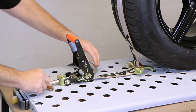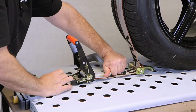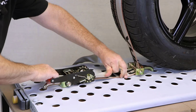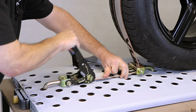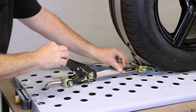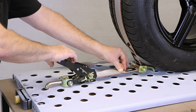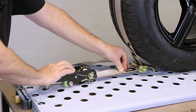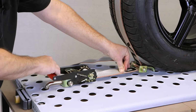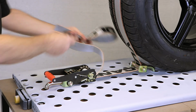Once you've decided where to place it, you insert your hook and remove all slack by hand, and then you use the ratchet device to crank. And you'll have plenty of tension in this device to move on your way. Over tensioning is a common error. Once you've got it tensioned, pull up on the release, place the ratchet into the locking position so that it doesn't lift anymore, secure your additional webbing, and go on your way.